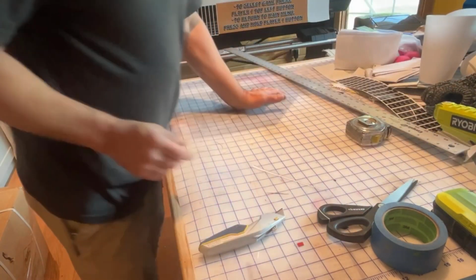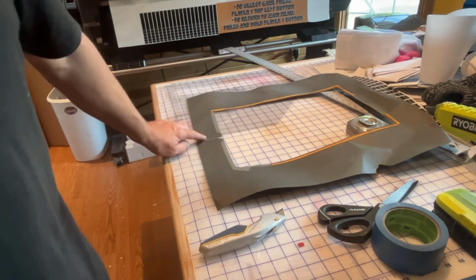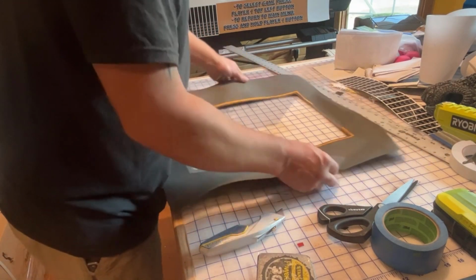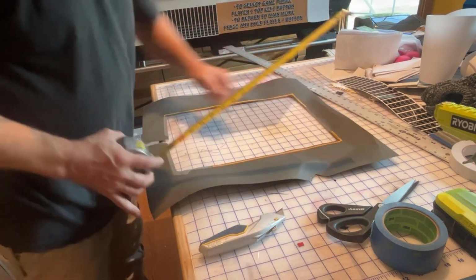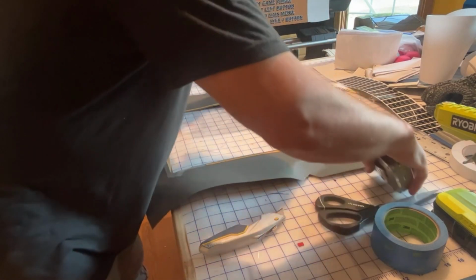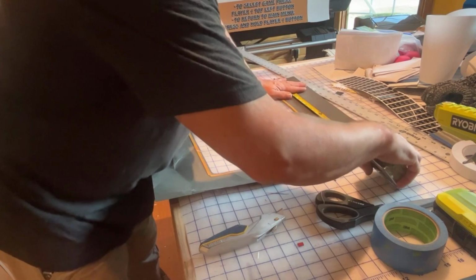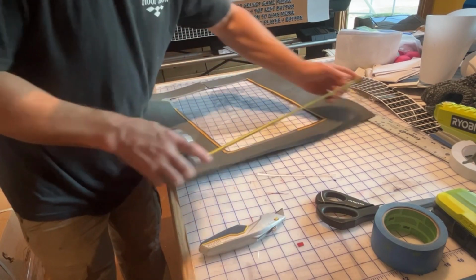Now we need to make the screen part, which is right here. Now they staple this together right on that one part where the slit is, but we're not gonna staple it. We're gonna use this very thin double-sided tape when we put it together, and we'll tape that seam together. So first thing I need to do is let's cut it to the size of the outer shape. So we're going to measure up here because this is one consistent piece. It doesn't have a slit in it. So obviously the width here is going to be different than the width here because they put a slit there and it's separated. So 22, this is actually 22 1/4. That back piece was 22 3/8. So we're going to go 22 1/4 by 21 7/8. So 22 1/4, I believe I said. 22 1/4.